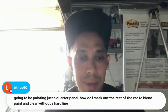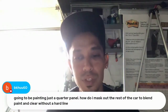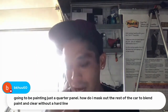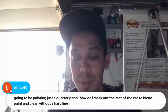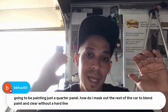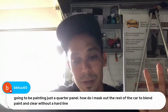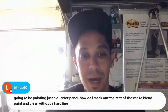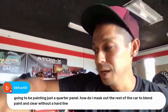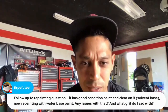For masking to blend paint and clear without a hard line: we just covered this on the BMW project where we painted the front bumper cover and blended into the fender, then clear-coated the whole fender. You have to blend into the adjacent panel and clear coat that whole panel for a good blend. Spray gun technique matters too. We have step-by-step videos on this in VIP.